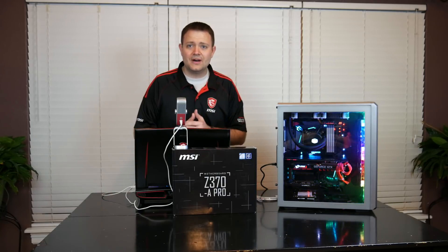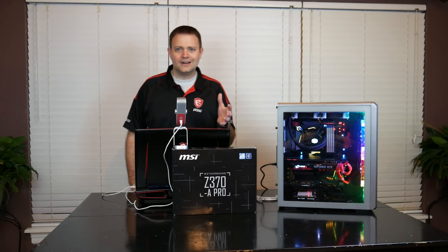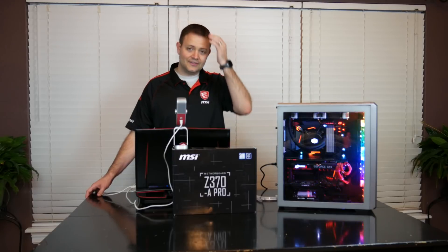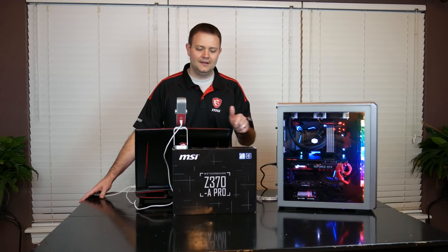Let's get into this thing. I'm going to unbox it, show you what it comes with, and show you all the basic features. This motherboard runs right around $100, which for a Z370 chipset is pretty good. If you're not going to overclock, you don't necessarily have to have the Z370 chipset — there are others. For instance, in the last generation of Intel boards you could get a Z270, which would have been the best chipset with overclocking support, or you could have gone to a B250 chipset — basically a way to get a cheaper motherboard and still use that same generation of processors. The nice thing about this is you get that Z370 chipset on a budget.